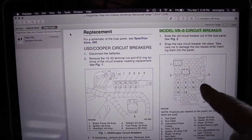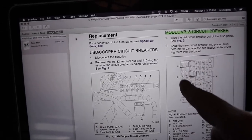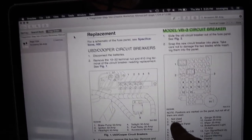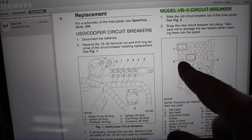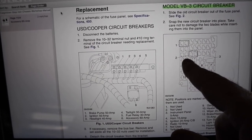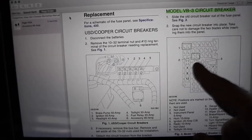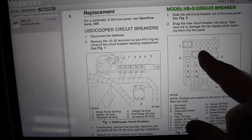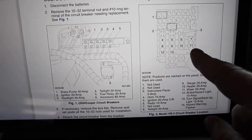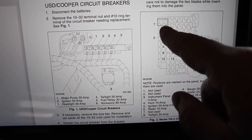This is the PDF wiring diagram manual and here is the layout of the fuse box. All of the problems are in this area — number one, which is not used. Basically these are reserved areas for you to run your own custom wires with your own fuses, and that's the block that seems to be dead. Originally the wiper was on number 11 down here in this corner, and when we rewired it we put it up here with a direct wire.